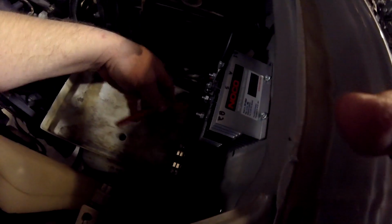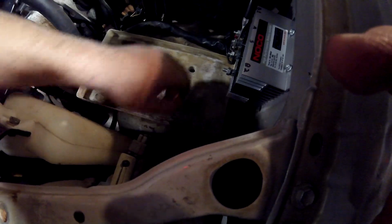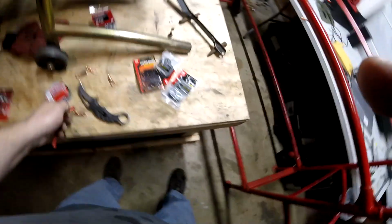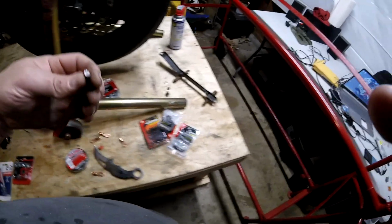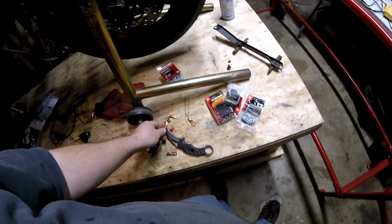I found a good place for the battery. The battery's going to sit here, and that's the B2 terminal I need to get from. So I found the right lug size to fit that terminal. It's one of the smaller of the 2 commonly available holes. So then you just take a knife and strip this insulation. A lot of you professionals will say, oh, you're supposed to use proper wire strippers. Well, who's got proper wire strippers at their house for 4 gauge? Sorry. So just cut about that much off with your knife.